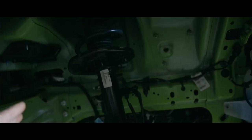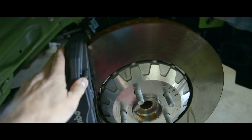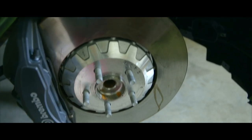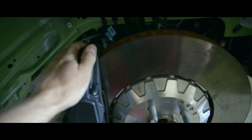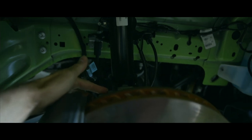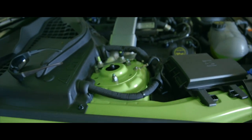This is going to be a relatively easy install — I've done this a bunch of times. I'm not going to be removing the rotor or the caliper. You're supposed to do that so you don't break the suspension by having all this weight hanging off it, but I'm going to be supporting the rotor from the bottom like I normally do. I'm just going to be taking these two clips off, then the sway bar end link, then these two bolts which connect the knuckle to the strut housing, and then the three on the top, and it comes right out.